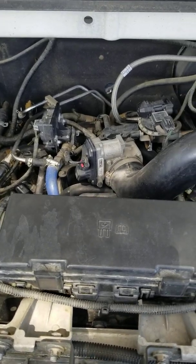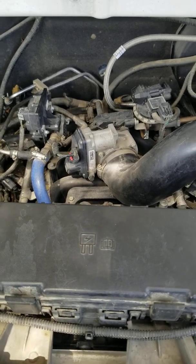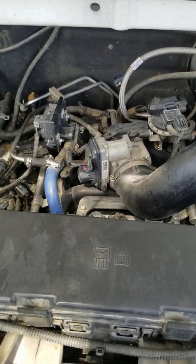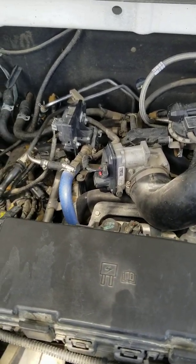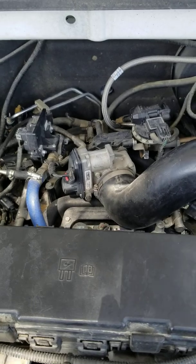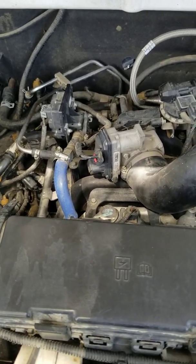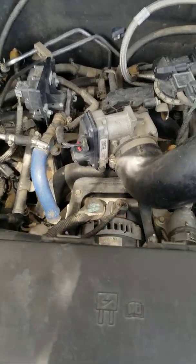We're back on the MV1 this morning. Last time it was in our workshop, it had a check engine light on and there was a random misfire on cylinder 4 and cylinder 7. So the owner wanted to replace the coil packs, which look like this, and the spark plugs on this 4.6 liter. Also, when we were doing the timing chains on this vehicle, this engine has a lot of EMI noise that comes from it.